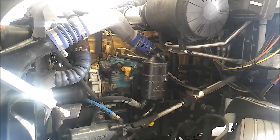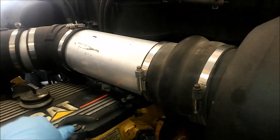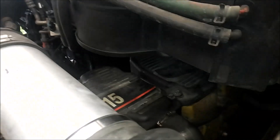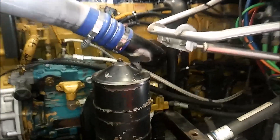So what we have here is a single turbo C-15 in a Kenworth. I'm going to be changing all the injectors, but I'll show you how to do one of them. You're going to have to remove any intake tubing and the valve covers. Sometimes you have cooling hoses — whatever's over the valve covers you're going to have to remove, and then the valve covers themselves. I have already removed the intake tubing and the valve covers, as you can see.